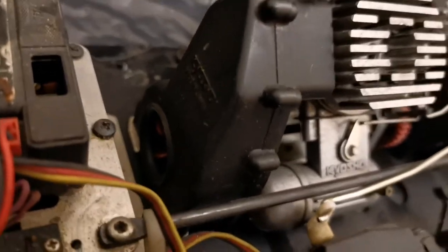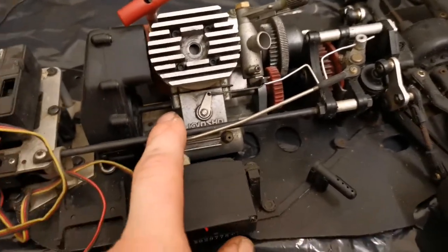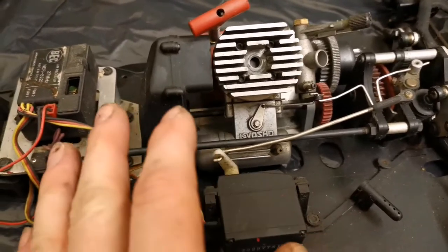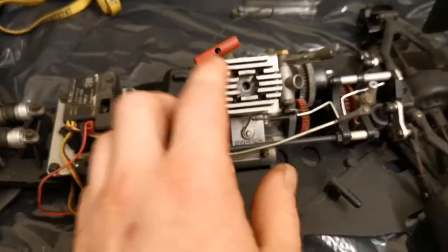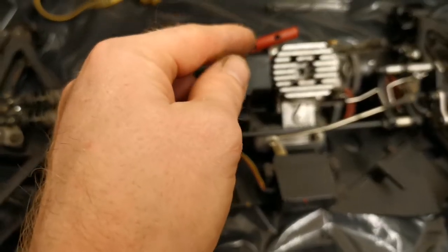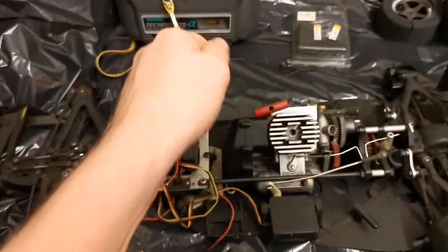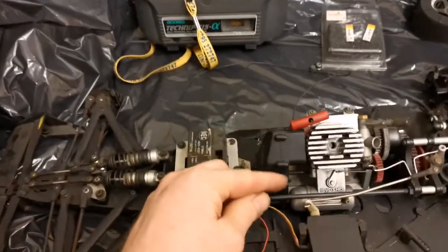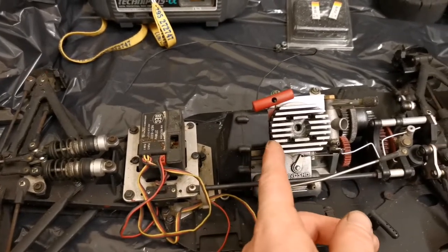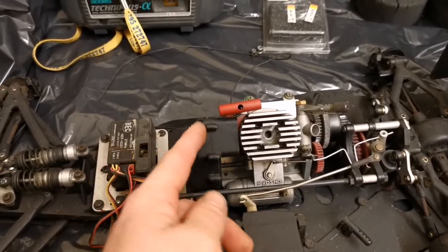Another interesting feature - what the hell is this thing on the side? I've seen this with Kyosho before but not in this fashion. They did a Barjar Field Bug in 1992 - some of you might have had it - a very odd setup, a little nitro two-stroke glow engine monster truck. It had a little rubber band that came up off a crank flywheel pulley, attached to a standalone fan mount. It was almost like those things you used to pull the string on as a kid and they'd fly off - a tiny one on a little pole, almost like a wind turbine - basically just cooling the head of the motor. When the crank spun, it would spin the larger pulley to spin the belt and spin the fan to cool the head.